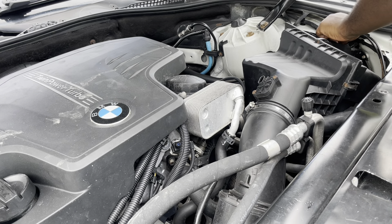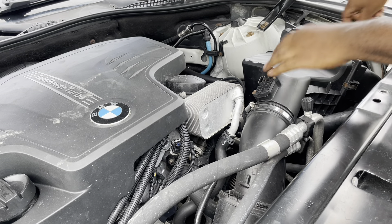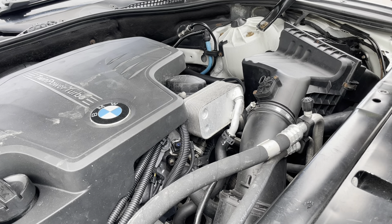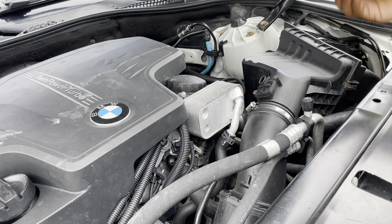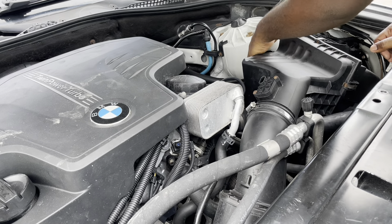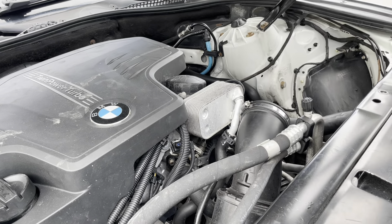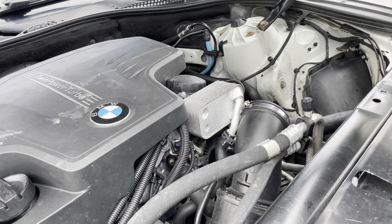After moving this hose, you're going to want a 10 millimeter. Mine over here is actually kind of loose already, so I'm gonna just use my finger and take it off — I kind of cracked them the other day when I was looking through it. Make sure you put down your parts in a safe spot. Disconnect from here — loosen this first. And voila, we're getting in there.